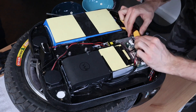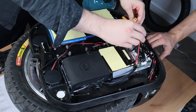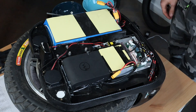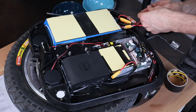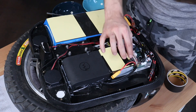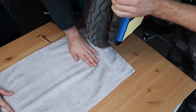Here you can see how we disconnect the XT90 plug, which has a fuse inside. I don't recommend working on your wheels on your own — better send it to a professional. However, we've already disassembled a couple of wheels. Right now the motherboard has no power supply, and we press the on/off button to let the capacitors discharge before opening up the other side.